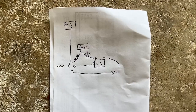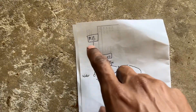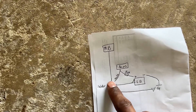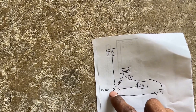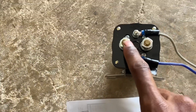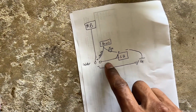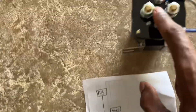Let me explain the diagram — you're looking at the car from the top down. This is the front hood, this is the main battery, and if you already have amps you'll already have a zero-gauge power wire going to them. What you do is unplug that wire from your amp and plug it into one side of the isolator. The isolator has two big terminals — one from the main battery power wire, and one going to the positive of the secondary battery.